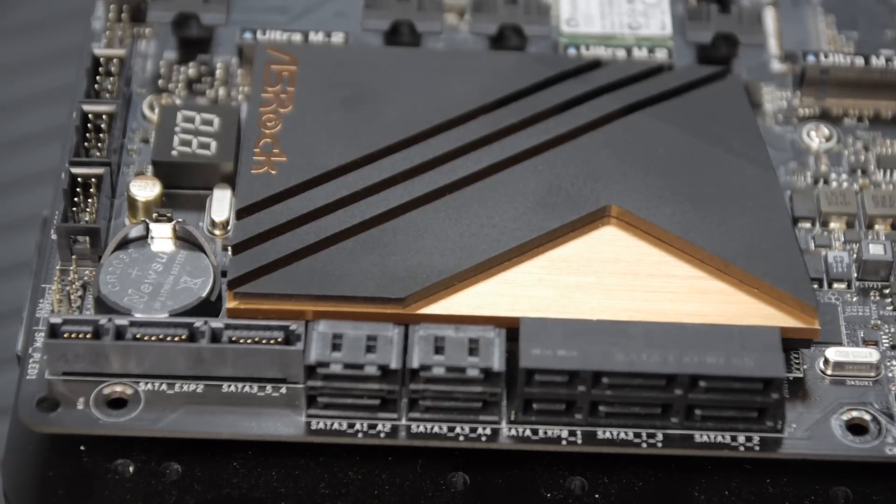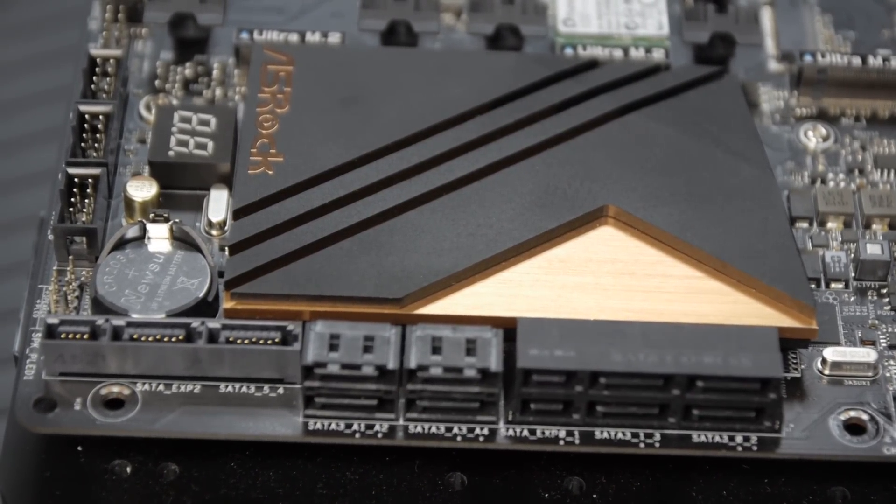The CPU connects to the chipset through DMI 3.0, which opens up four more PCI Express Gen 3 lanes available to the rest of the motherboard. That is how ASRock has implemented the rest of the peripherals on the system. There are three SATA Express ports on this, and it comes with a SATA Express peripheral which is a USB 3.1 adapter.